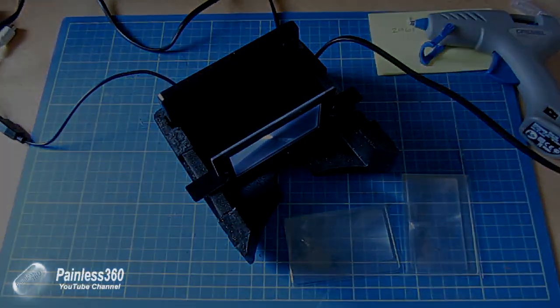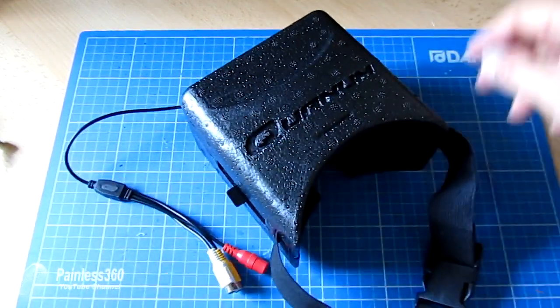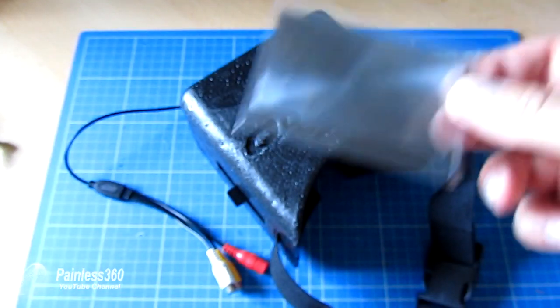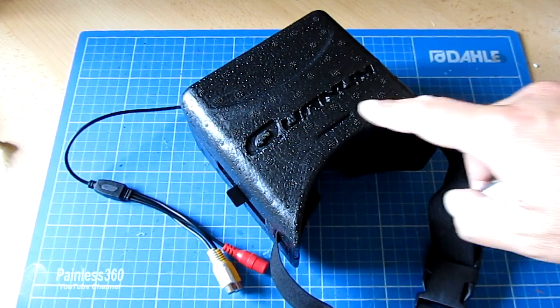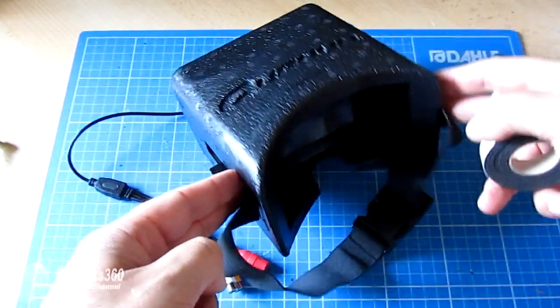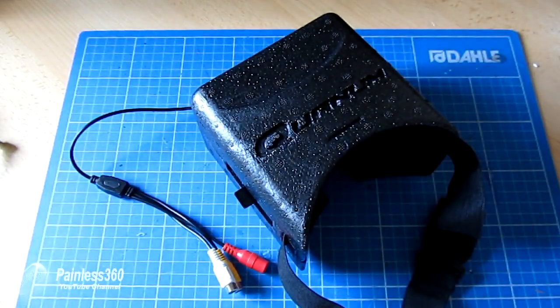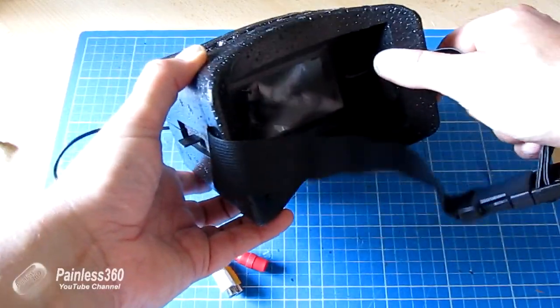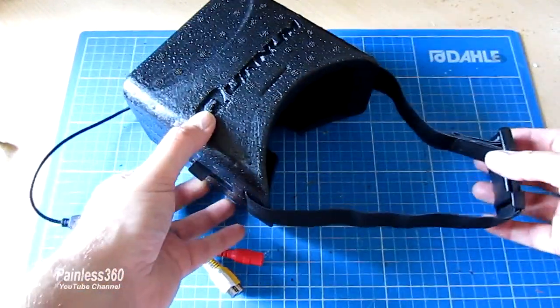Here they are put together with the lens I liked in it. Interestingly, of the three lenses, one seemed very poor quality. One made the screen look like it was an IMAX screen but gave quite a bit of distortion at the edges - very immersive, but sacrificing quality was too much for me. The middle one was perfect, and that's what's in here. I put it together using foam tape, double-sided at the front and back, and that worked great. For the head strap, I just pushed it through, rolled it over with a very thin line of hot glue, and then one last line of hot glue to hold it into the edge - and that works great.